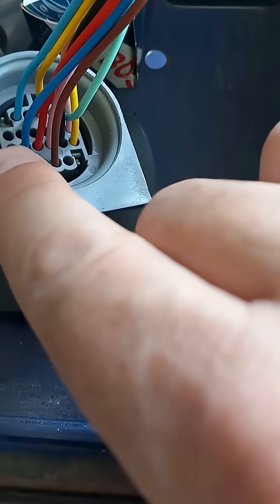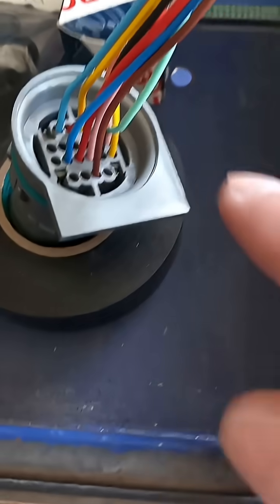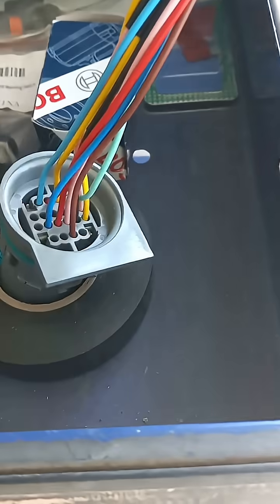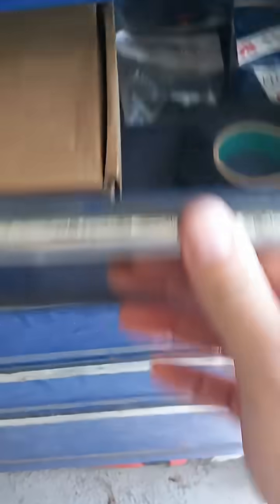This brown wire needs to be next to the blue one. Usually there's a white wire - as you've seen earlier in this clip, that's the one I removed, and I switched the brown for that. So all this time, I haven't been getting a signal, which is why the converter hasn't locked. I've been chasing my tail for, I don't know,